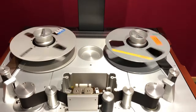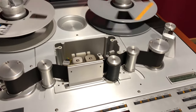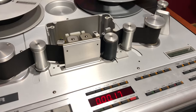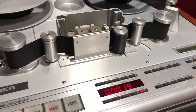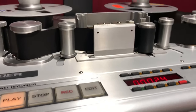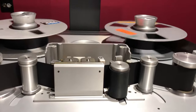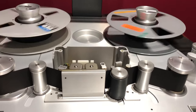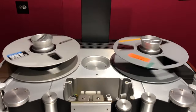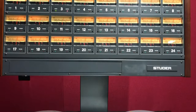Here we have an overview of the transport and the lineage of the A820 is unmistakable, with the space ball hubs capable of taking 14-inch reels, the many guides and rollers either side of the head block, the forward mounting pinch roller contacting with the back of the tape, and head type aside, the same head block design. In the front are the large transport buttons that Studer adopted for all their large footprint machines, from the A80 onwards.